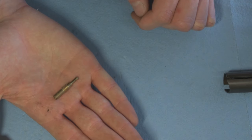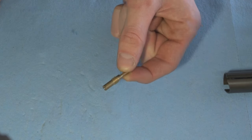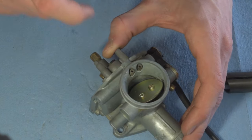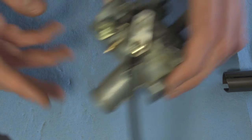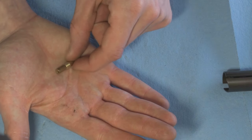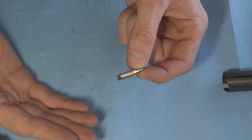The second piece is the pilot jet. The pilot jet handles the mixture from idle to 15–20% throttle. Air comes in through the front of the carburetor where the choke is, drawing up fuel through the pilot circuit via vacuum as air flows through. If you're having issues with idling or the bike starting, the culprit might be the pilot jet, also known as the idle jet.